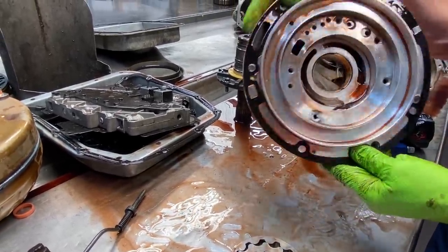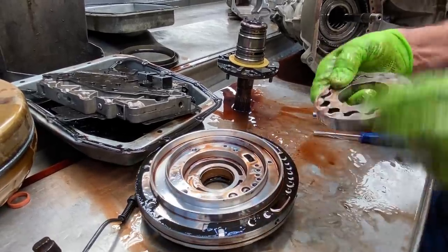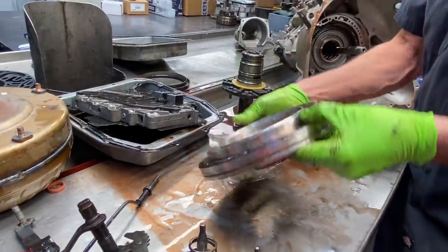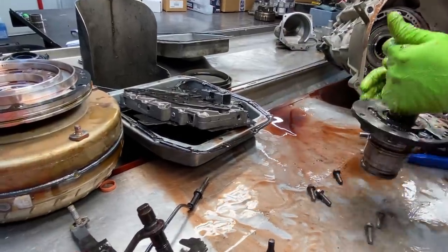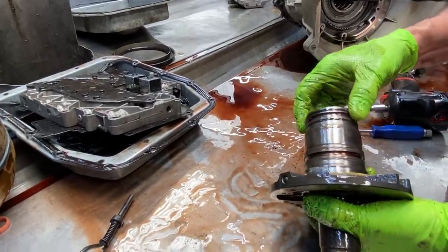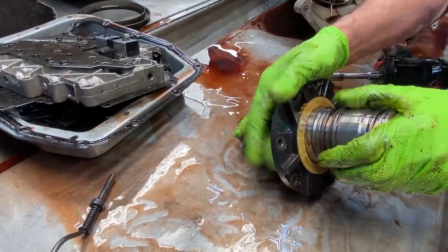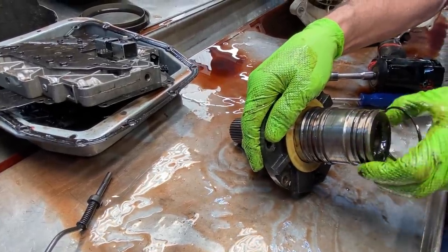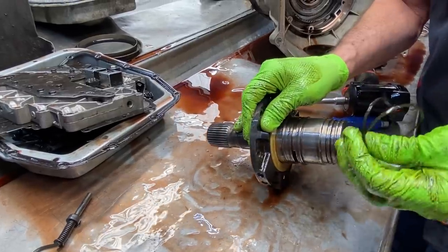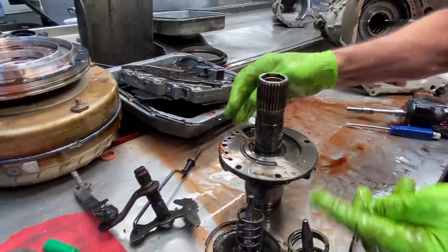We have our pump gears and pump assembly, pump body. Look at it really close — we've got new gears going in. Everything looks good, don't see any real scuffing, probably from just the trash that's been running through, but nothing really major. We have our pump stator. Your kit could come with different forward rings here, but all your reverse rings right here are always going to be metal. The forward ones could be plastic or metal. Your shift kit could even have its own variation of ring type it wants you to put in.